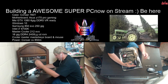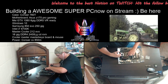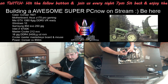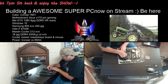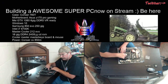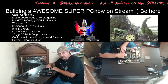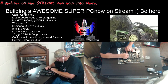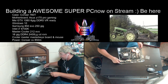Alright. On the motherboard, there's a little dot. And on the bottom of the processor, there's a little dot. And that's the direction. And on the top, there's an arrow right here that goes to the dot on the motherboard so that you know you're properly inserting your i7 processor. Then we're going to lock that into place, like so. Our processor has now been installed to the motherboard.